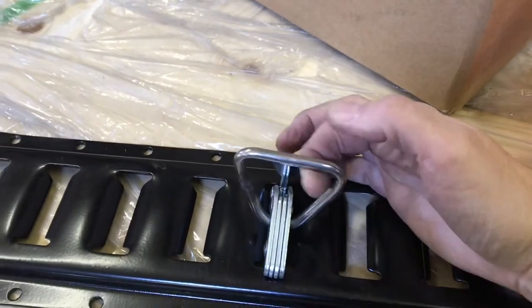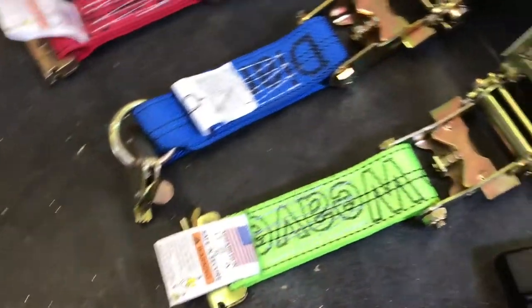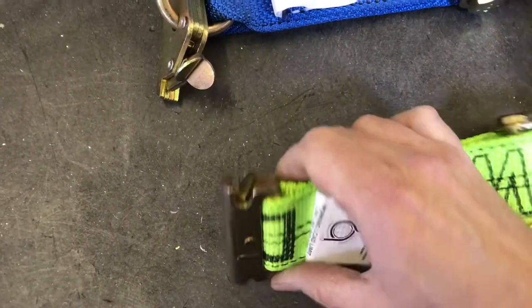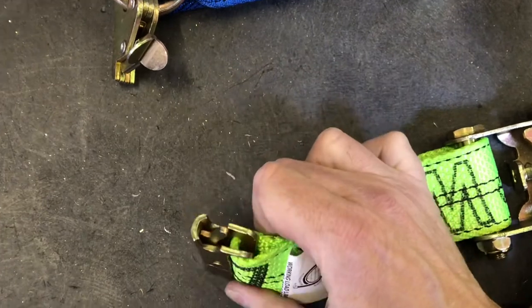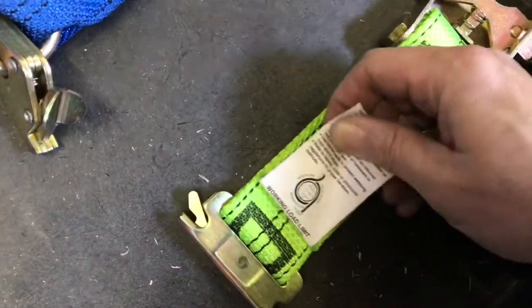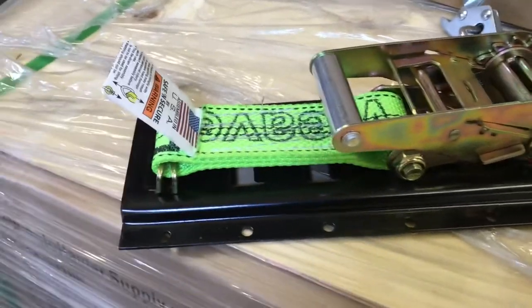Another idler also works really well in vertical e-track — in that vertical style it's going to have very low clearance. Another thing to think about for enclosed auto transport is what hardware you're going to put on your ratchets. For horizontal e-track, this is a great item — the most low-profile one we have is what we'd call a flat e-track or spring e-fitting. A lot of them on the market are 3,000-pound break strength, but we buy 6,000-pound break strength so we can tag the whole assembly at one-third of ultimate strength — 2,000 pounds. This lays down flat; it's a great option for horizontal e-track.